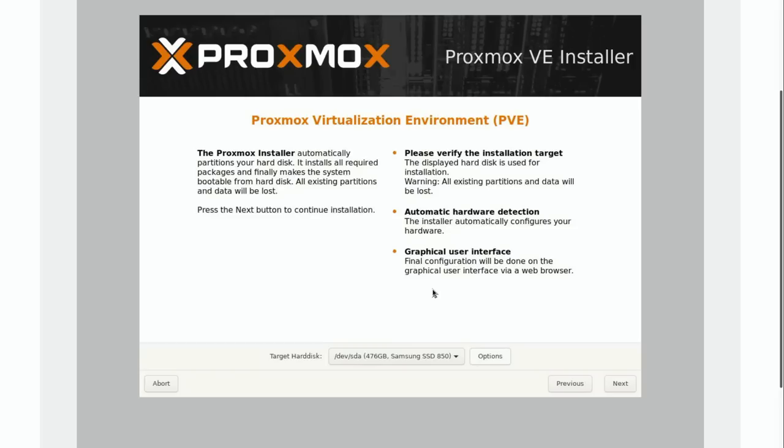Samsung SSDs are great, but these particular SSDs in my experience don't work well with ZFS. So I'll just go with a single drive for now. I definitely do prefer at least RAID 1 for redundancy, but I do have backups of backups of backups — I'm not really too worried about losing anything. So I'll install it on the first SSD and figure out what to do with the other SSD later.